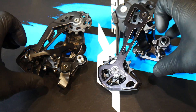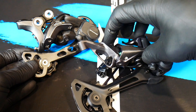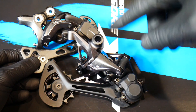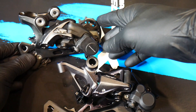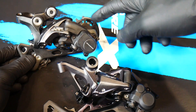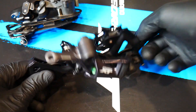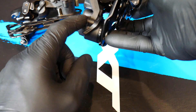Both pulleys have bearings on both the older and newer derailleur. As for materials, what hasn't changed: the XT derailleurs are made of aluminum with bushings and bolts made of stainless steel. There is one part made of so-called GFRP — glass fiber reinforced polymer. Shimano's manual states the body plate is made of GFRP. The outer plate and inner plate are made of aluminum. If I'm wrong about which part is GFRP, please correct me in the comments.